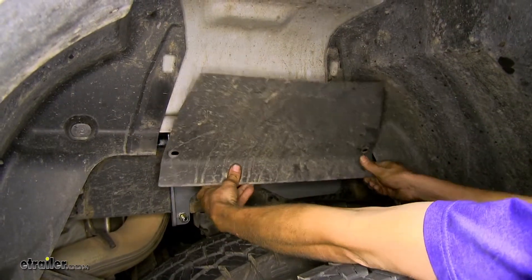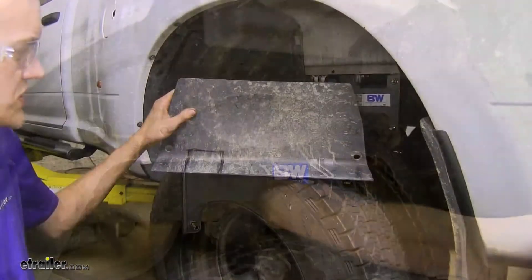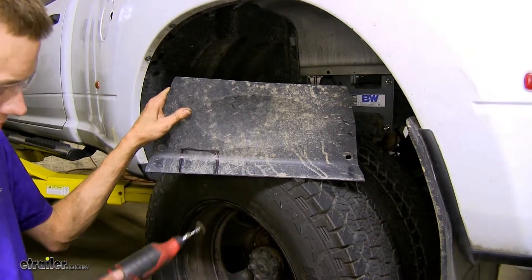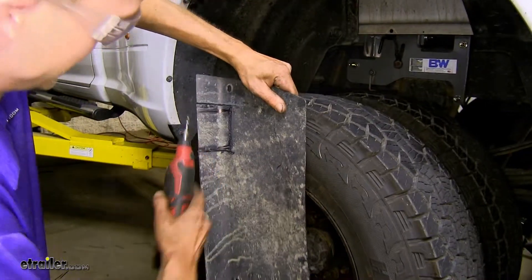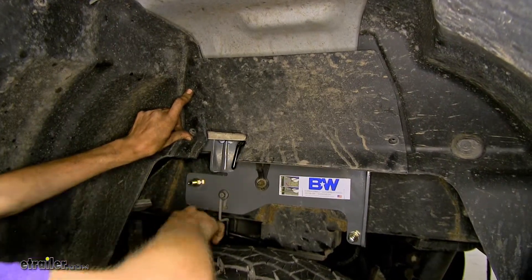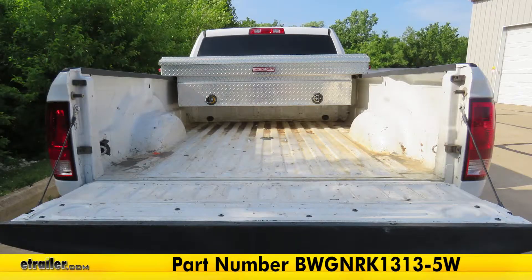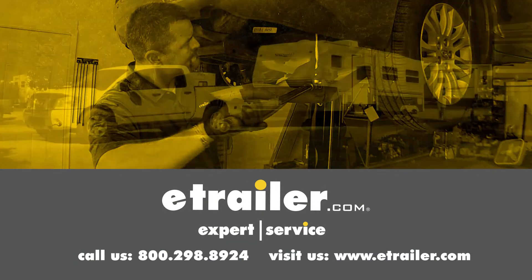Now we'll reinstall our side panels. On our driver's side panel, we're going to need to make a notch in this area so our handle will be able to operate properly. I'll use our rotary tool again — you can also use a utility knife. With that notch made, you can just grab and break it off. We'll take our panel, hang it back in place, and you'll see we have plenty of operation room for the handle now. That completes our installation of the B&W Custom Underbed Installation Kit for B&W Companion 5th Wheel Trailer Hitches, part number BWGNRK1313-5W, on our 2012 Ram 3500. Thanks for watching — click the link in our description below to shop, learn more, or visit us at eTrailer.com. Leave us a comment if you have any questions.